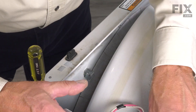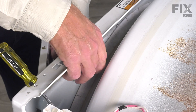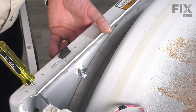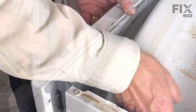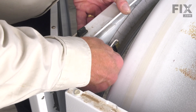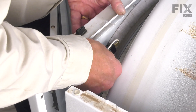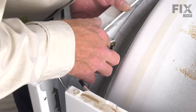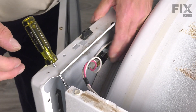With the switch wired up properly, we're just going to set that aside. We'll open the dryer door and remove the old bracket if it's damaged — if not, you can reuse that one. We'll just slide the new one in through that opening. It's helpful when reinstalling the switch in that bracket to leave the dryer door open so that you can hold that bracket in place. We'll then take that switch, tuck it under one edge of that metal bracket — either top or bottom — line it up so that the button goes through the center of the hole, press the switch into place, and then make sure the clip captures both edges of that switch.